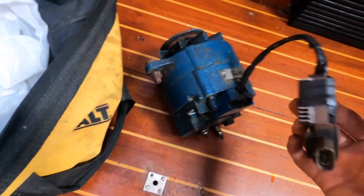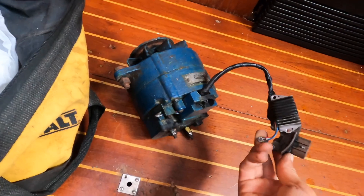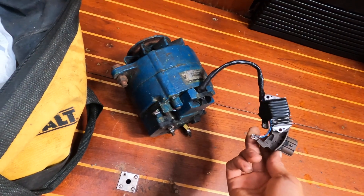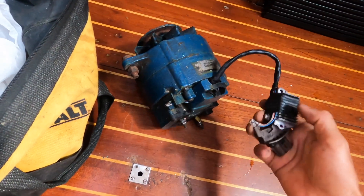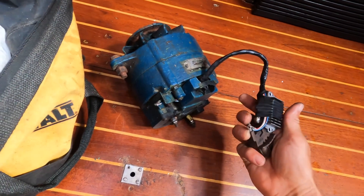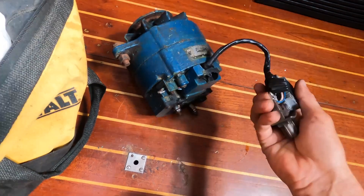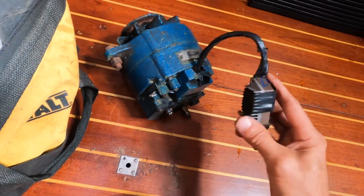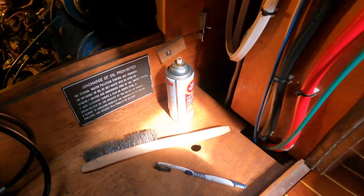What they did was hooked up a voltage regulator for a truck. So instead of an internal one, it's going to be an external voltage regulator. They taped it up like that over top of this heat sink. I hope that's not going to be an issue — I think I might revisit that before I install it. It's already been soldered together. I would have liked to put shrink wrap on that, but I'll make it work. So that's what we're going to be doing today.